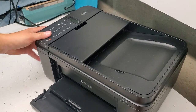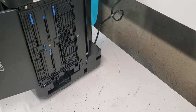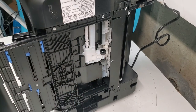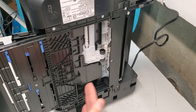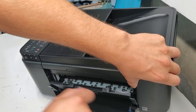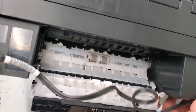Pull out whatever paper you have. Another issue could be paper stuck somewhere halfway in there, and there are a couple of ways to check. We can put the printer on its side to see better, then pull the tray open. We have access to the rollers here — make sure there's no paper stuck in here. If something ripped, check inside the printer by opening the front door and shining some light in there. Then check by opening the back cover and making sure that area is all clear.